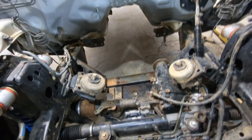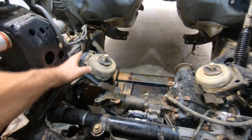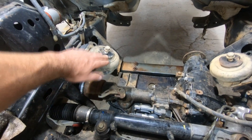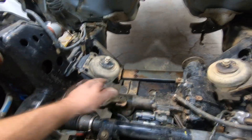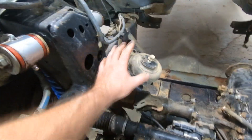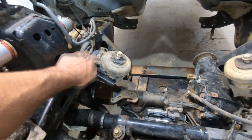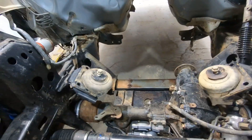I've got a pretty good idea what's going to need trimmed off to get it to sit in there straight. Both of these are going to need cut off, but I at least need to cut this side off to test fit it. I should also mention the angle is a little different on the Tacoma mounts versus the Tundra mounts. I'm not going to worry about that because I'm going to bolt these to the engine, drop it in while they're bolted to the brackets, tack the brackets in, then pull the whole engine out and weld them. So I'm not even worried about that little bit of angle.